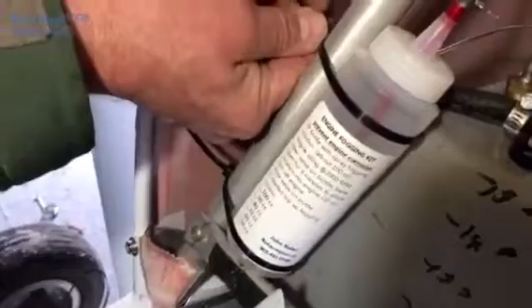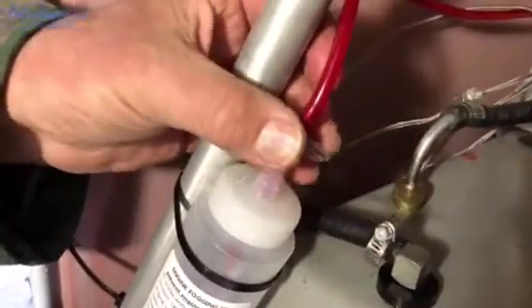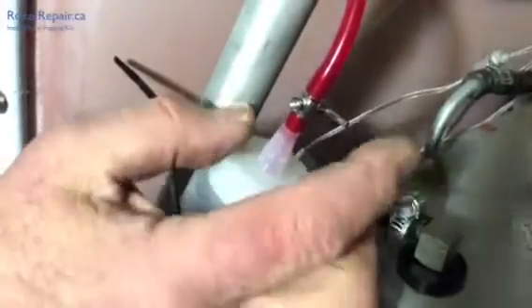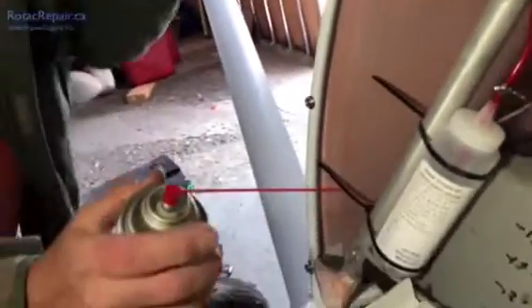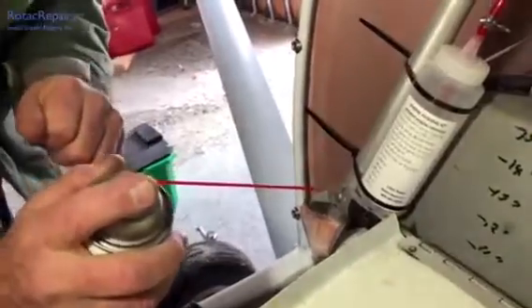I'm not going to crush the bottle, but I do want to make sure it's secured on tightly. We also want to make sure that we've rotated it around so the valve is on the very back so that we can't accidentally brush it. It's in the closed position right now. The open position is when it's in line down like that. Next we want to fill the bottle to the appropriate level — I would suggest putting 100 cc's in it.